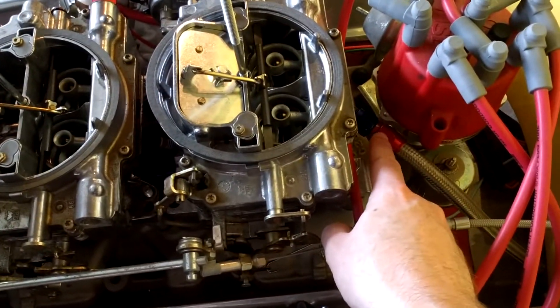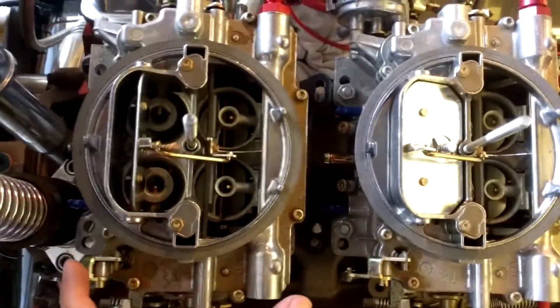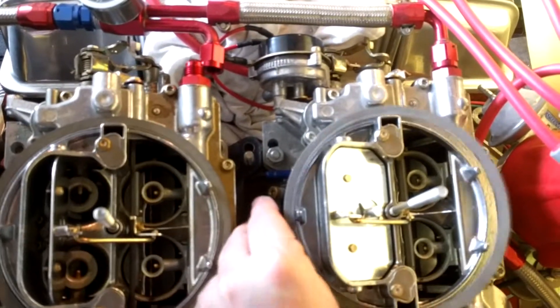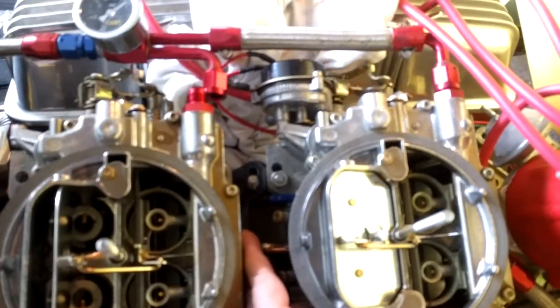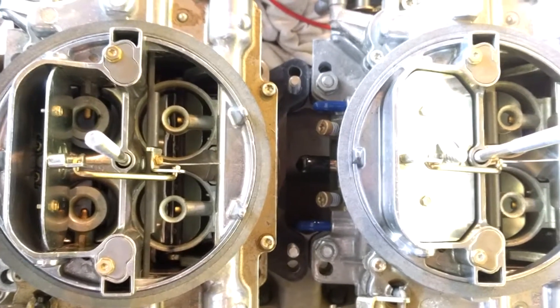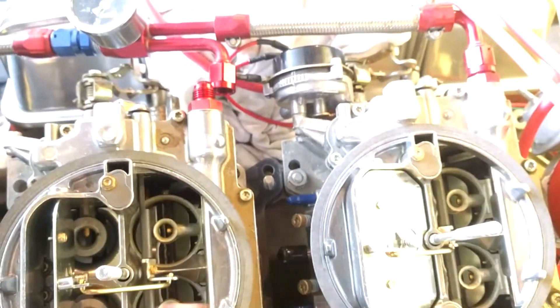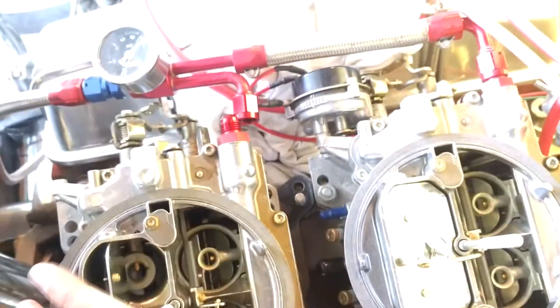Hopefully the vacuum leak's gone. The other leak was coming from a fitting over here, which we tightened up. The carb popped off pretty easily — I just slid it over a little bit so I can get my fingers in there, and I didn't have to undo the linkage. I got the old boot off, which was split all the way around. Got the new boot on — nice. Now I need to bolt it back up, being really careful not to drop anything down these holes, because that's a bad situation. There were four washers on here — I had to pull those off so I didn't drop them in the hole, because that'll ruin your motor.